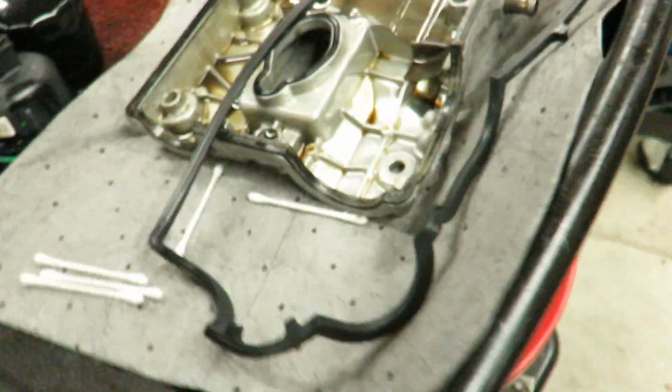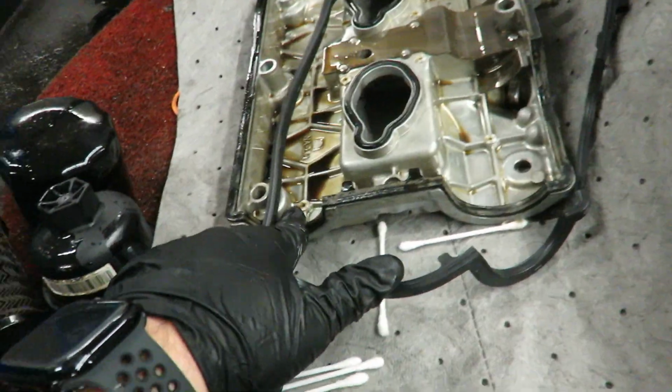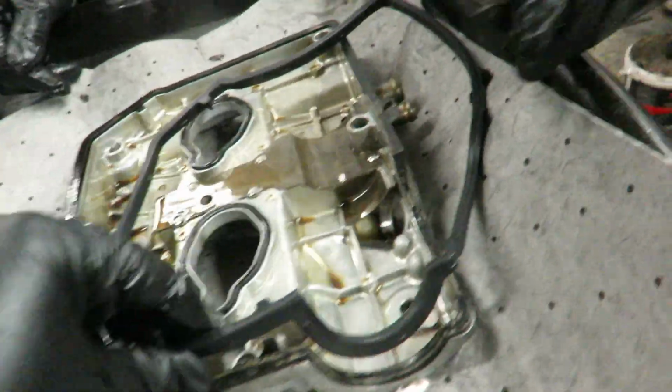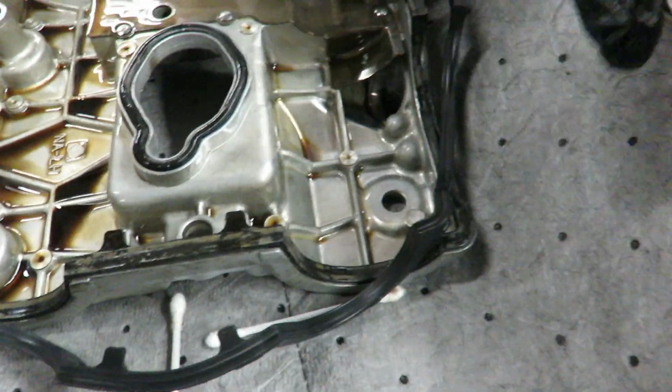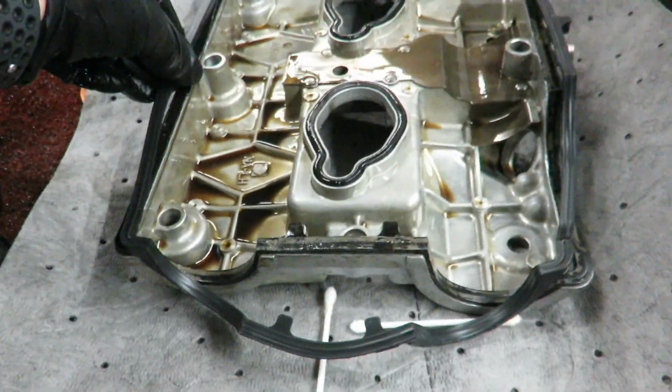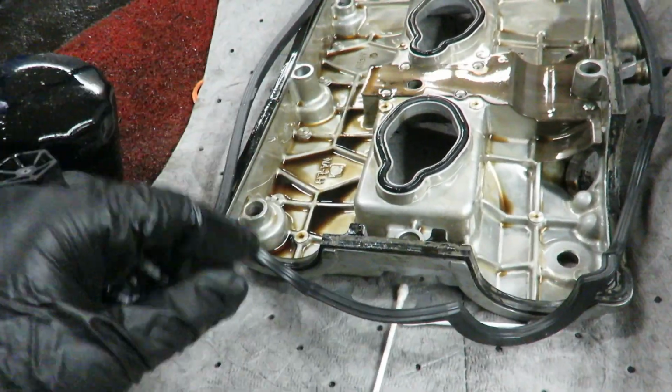Engine looks pretty good. I mean, it should be a healthy engine. It's a JDM engine, so it shouldn't have a lot of miles on it. But last time when I had the engine out, I didn't do the valve covers. I had them, but they were the wrong ones because this one's AVCS. In the US one, they don't have these double curves, or at least the gasket that I ordered didn't have these double curves. So I had to special order these from a special website. They were like 10 bucks a pop, left and right. But these fit, so let's keep on going with it.